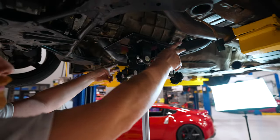That's not the pilot bushing that should be in this car. Dave, you blew your motor. That's an autopilot bushing that's been hogged out. The bronze pilot bushing in there looks beat to hell. Oh boy. What'd you do? I didn't do it. One eternity later. Yeah, no. Wiggling, it's not coming further out.